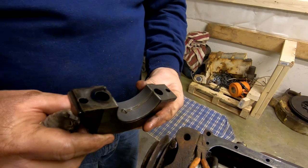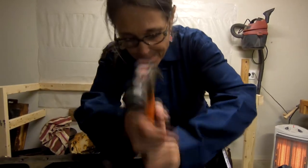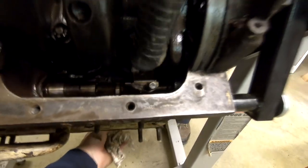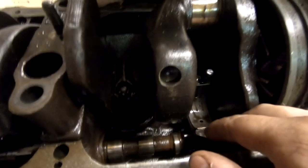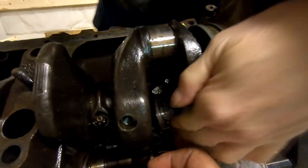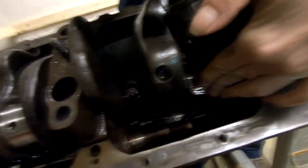Oh. Yeah, pretty decent. It's going to give you a little bit more resistance. It's not done yet. Oh, it bent. No, it didn't. It just rolled because it's loose. It's on a bearing. Okay, then what you do is you support this up here like that. Put the blunt end into your hammer right there. Yeah. Go straight down. And then catch it on the other side.